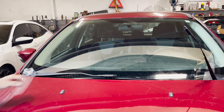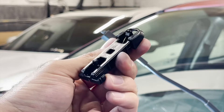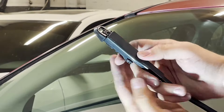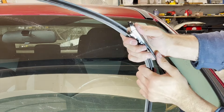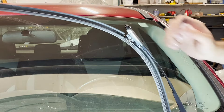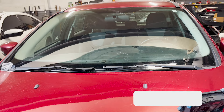Now we jump to the driver side. We'll take out the bracket from the new wiper, then install the new bracket in the wiper arm, pushing the bracket until the tab goes completely in, and finally install the wiper. With that, we are done replacing both the front wiper blades for the Ford Focus.